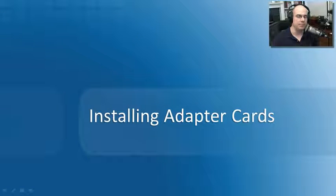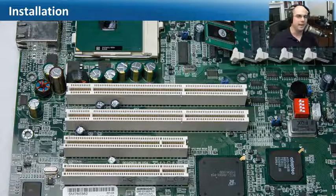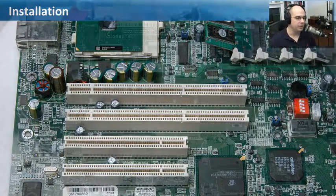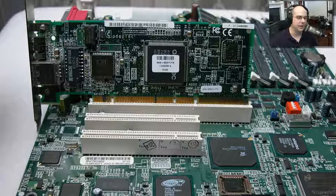The actual installation of an adapter card is relatively straightforward — it's difficult to mess this one up. The motherboard itself will have slots on there that are your expansion card slots. These happen to be PCI card slots. I've taken the motherboard out of the case so you can see this a little bit easier. You should see an adapter card that matches the slot you're plugging into. If the notches on your adapter card are not matching the slots and the keys inside of these adapter slots, do not put the card in there — it won't fit. If you're having to use a lot of force when pushing it down, don't do that. It should slide gently in and simply fit into the bottom of that particular slot.